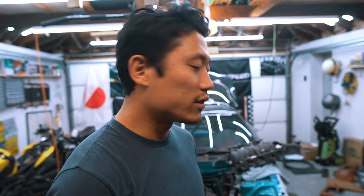One of the days I was working on my RX7 by myself in the garage trying to get it started, and my friend Raj from Evo 10 videos, the engine builder, stopped by my house, heard the car cranking, and he was like, you know, this is a brand new engine, but what if you check compression just to see what happens? And sure enough, when we did the compression test, we had zero compression on all of the cylinders except for one, which is very strange.